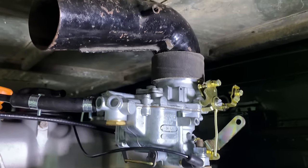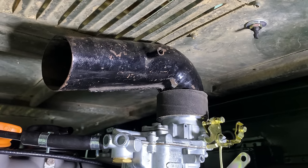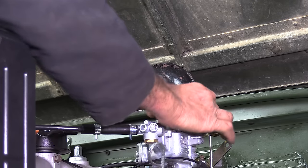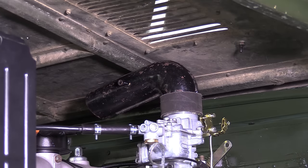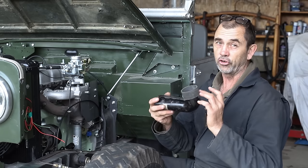You can see with our Land Rover intake on that we do just have clearance beneath the bonnet. So that works, but not in the direction that we need to go, which is across to the other side of the engine. Even then, the bonnet support bracket clips our intake and pushes it down. To resolve that issue, I don't even think we've got any more to trim here.